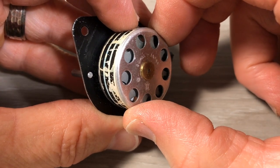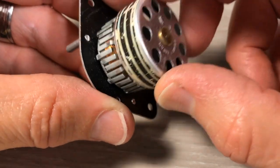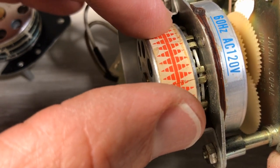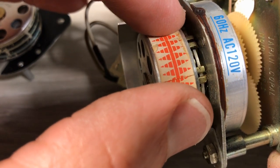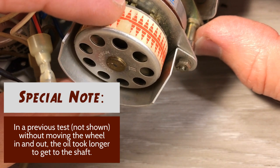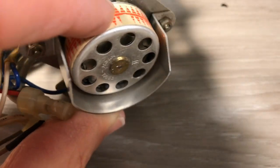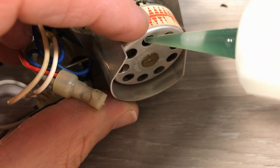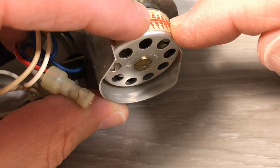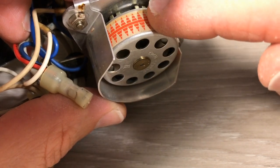You don't normally see the well in normal operation. You see how I'm moving the rotor in and out? That actually gets the oil into the well. A normal motor comes out about a millimeter. If you oil it and gently pull it out like that, it's going to help that oil get down into the well. You can over-pull and cause a wobble, but generally you won't unless you're too aggressive. So doing a little pulling may encourage the motor to get oiled more quickly. Be patient — drop the oil in there, do a couple of light pulls in and out to pulse that oil into the well, then spin it. If you can get the motor energized and get it running with your finger, that's going to work the oil down the axle and get your motor working again.